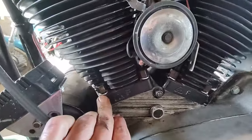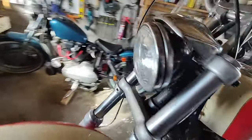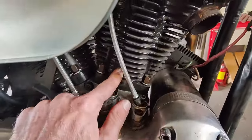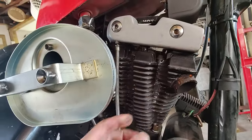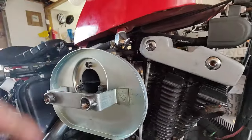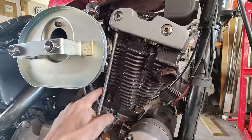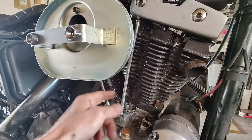Okay, so we have spring washers installed, the bolts are untightened at the moment. I have the spring washers in on this side, push rods are out, so the heads should be easy enough just to tighten up. I don't think there's gonna be the rubber bands, rubber grommets should be fine for the heads to move a little bit if they need to. So now I'm just gonna tighten everything down proper, torque it up, and put it back together.